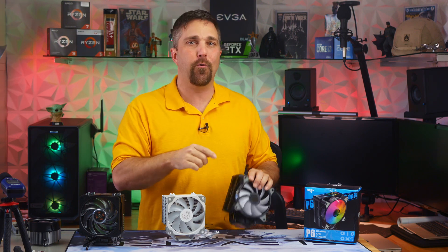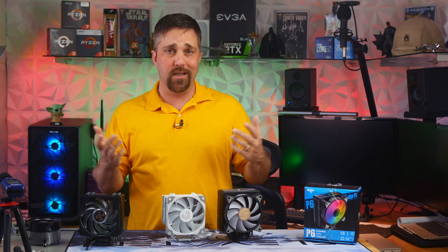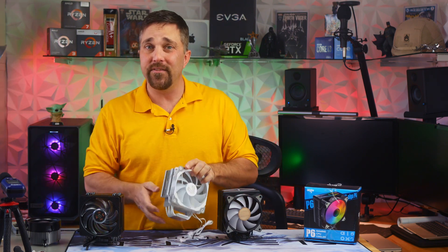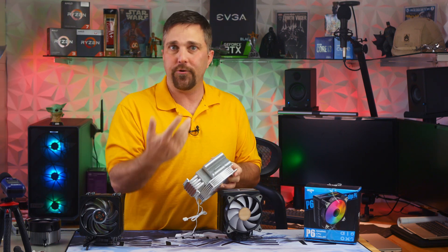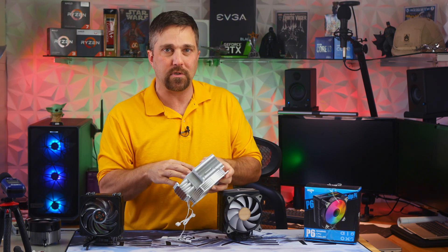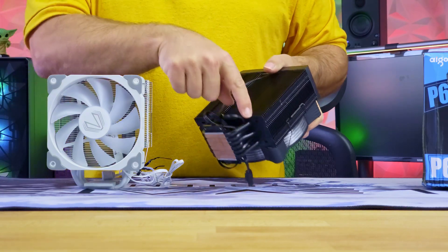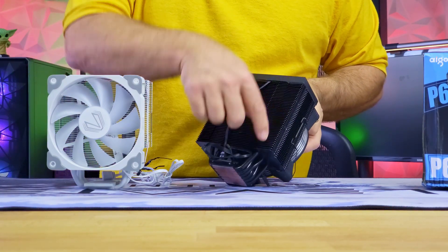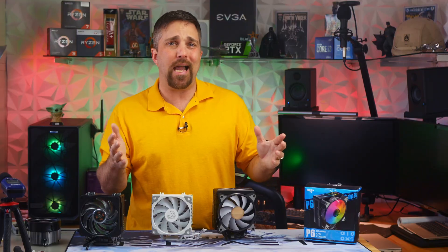I've already gone off-script from my typical cooler review — I skipped the stats, measurements, and installation process, because looking at my YouTube engagement stats, y'all typically skip that too. So I decided to see if I can improve the performance of this cooler. I can't fix whatever may be wrong with the heat pipes, but I can try to improve the efficiency — so I'm gonna vetro-fy it. Cut away the fins that are covered by the fan and see if removing that dead surface area helps. It seems counterintuitive to get better cooling by removing surface area, but let's just hack some stuff off and see if it works.